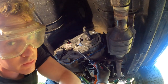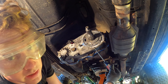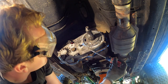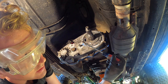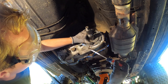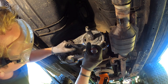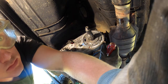I officially recommend that when you're installing this outer case, try to install the line into the oil pump before fully cranking everything down. If you've already got it cranked down with the sealant curing, here's how to fix it: there's a bit of play right here, so I'm going to get a smaller screwdriver and use it like a little piece of leverage to make it happen.